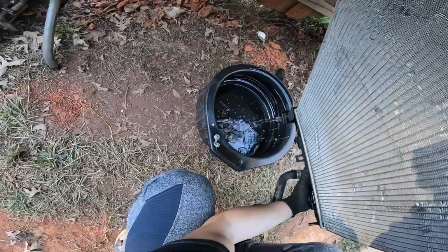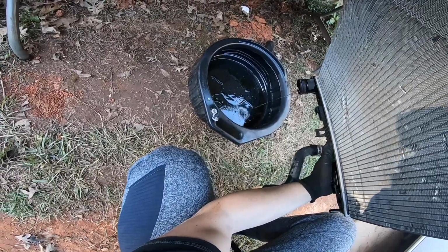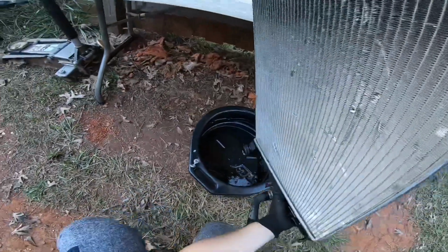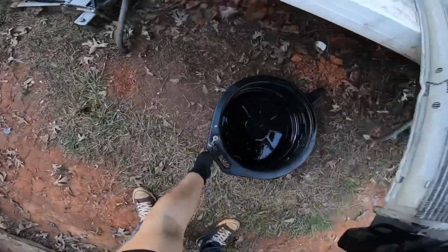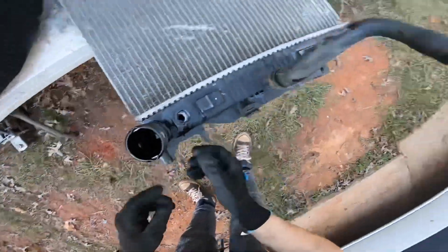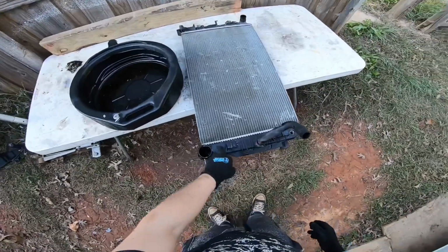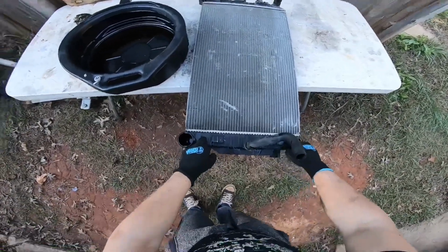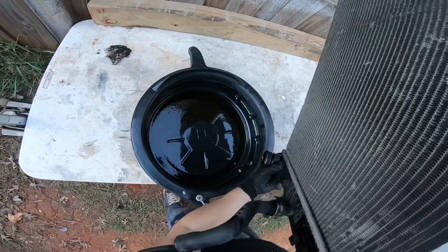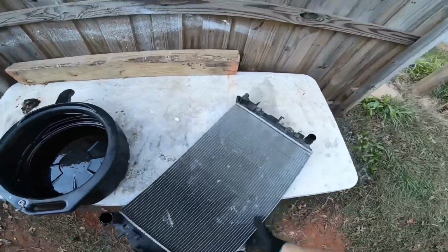Well, the oil, excuse me, once I'm pouring out the radiator fluid, it's coming out with oil. I do see oil now. This is actually, it was not really apparent. I'm not sure. Let's see. Okay, I could see why that oil's coming out. So basically, for some reason, this transmission fill-up tube is moving around, and what you see in there is not oil, it's transmission fluid. So that's what that is. Because it's kind of weird, it started coming out like that.